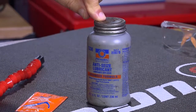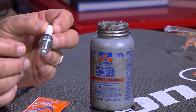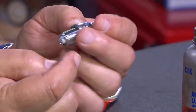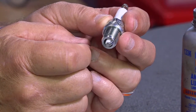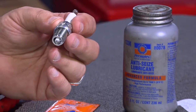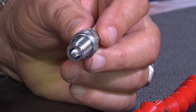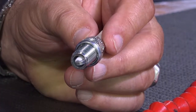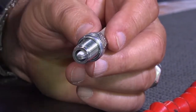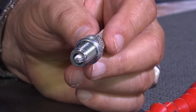You can buy it in smaller quantities. What you're going to do with anti-seize is when you get ready to put the spark plugs in, you put a tiny dot right here on the first thread on each side of the plug, 180 degrees apart. What you're trying to do is get some of this anti-seize in there, which will keep the plug from seizing into the head. You don't want a lot of it — just these tiny dots right there. As you turn the plug into the cylinder head, you will disperse that around the threads and it'll keep the plug from seizing. Too much, or putting grease on it, will turn into like glue and cause the plug to seize instead of making it free to come out.